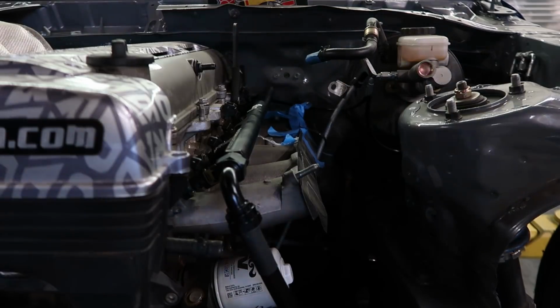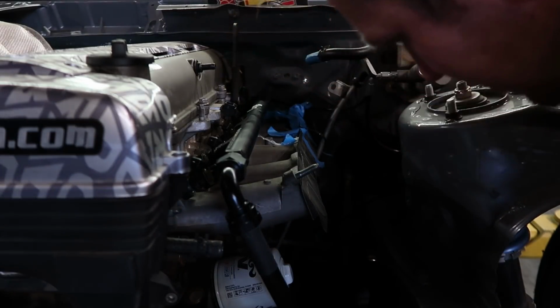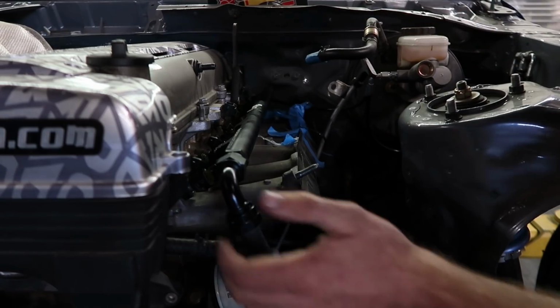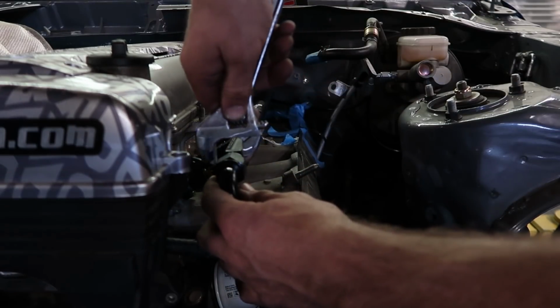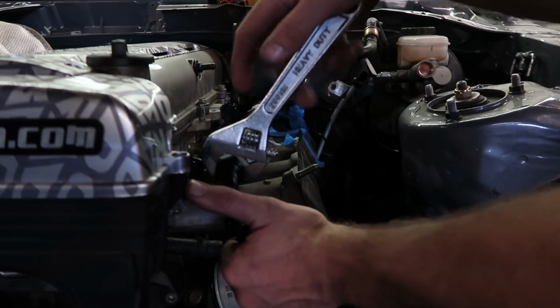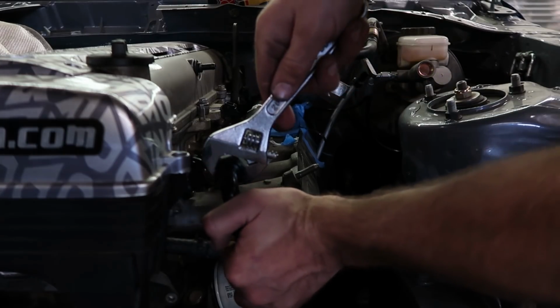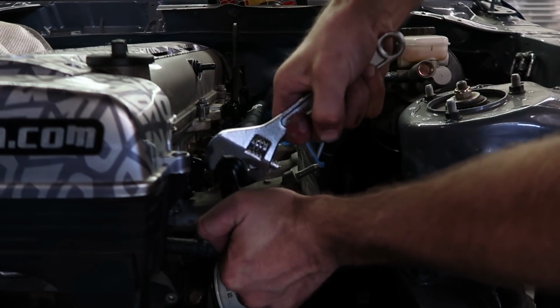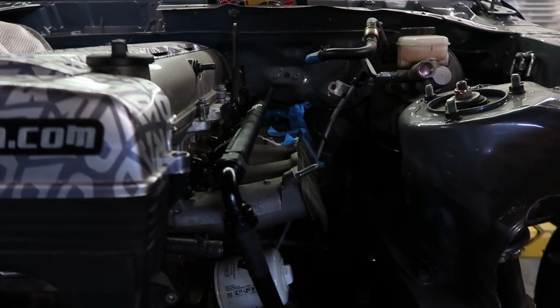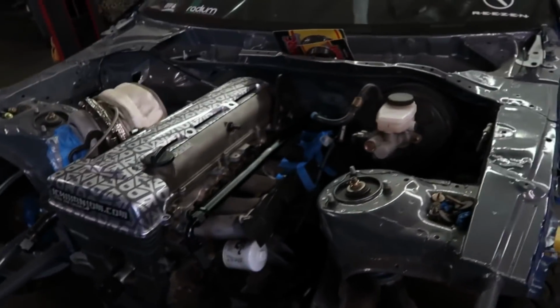You have your second pump come on probably around when boost starts to happen, and or your second and third pump come on when boost starts to happen. On my pro car, I like to do it at, I think it's 2800. I have my second pump come on. I have a lift pump and a normal pump going at all times, lift and feed.